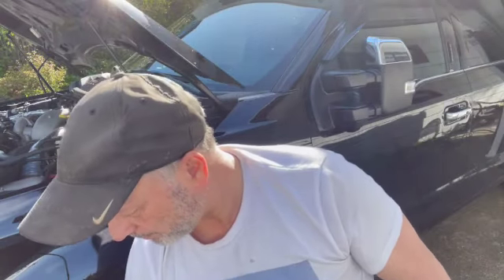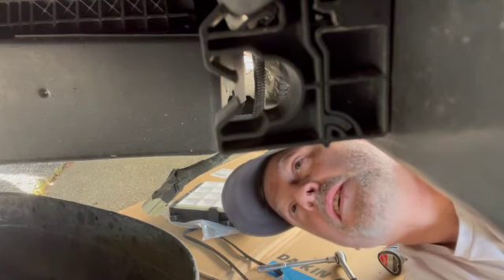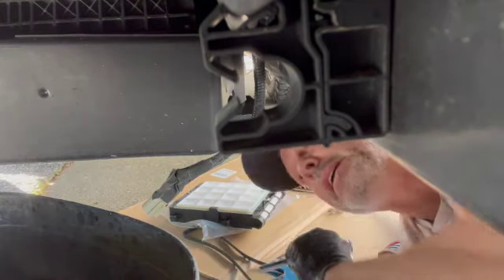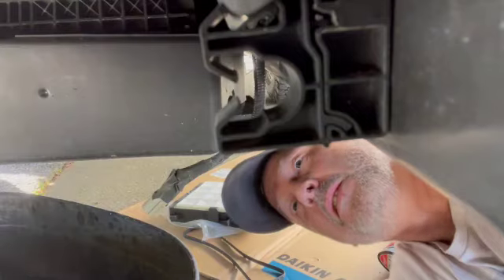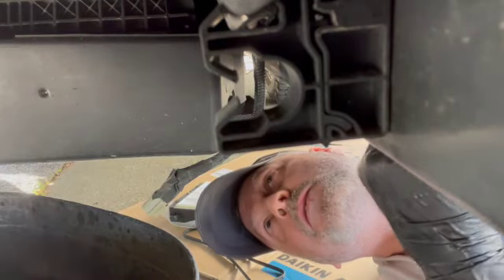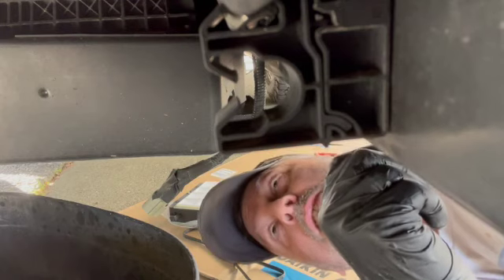It leaks from some of the other parts, so be careful how you handle it. Now working on the one underneath — it's still draining. I filled the tank up so hopefully I'm not going to drain the whole tank, but it seems to be slowing down. That yellow knob you turn to drain it is the same one you'd turn to get rid of any water in your fuel if you get a warning light on the dash.